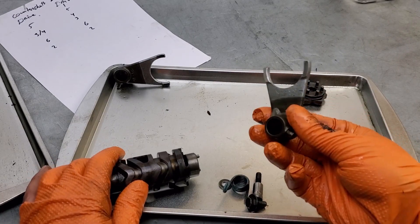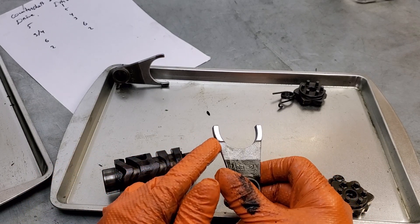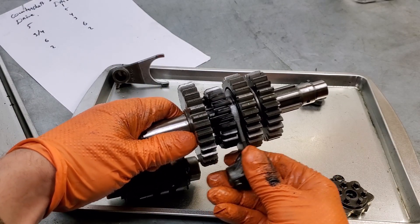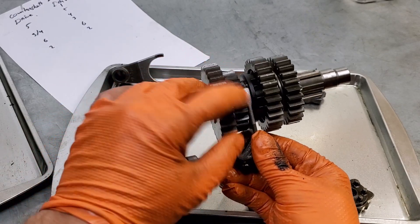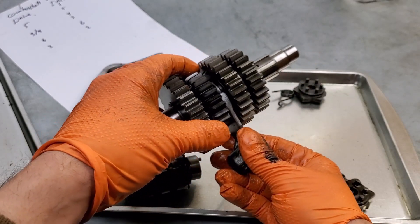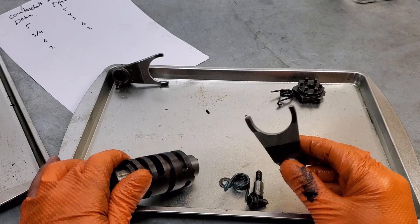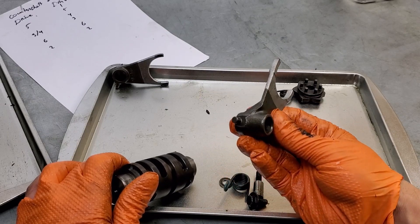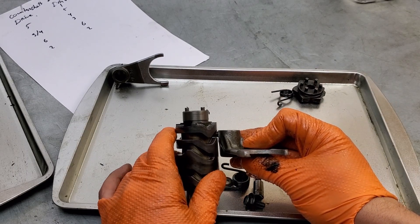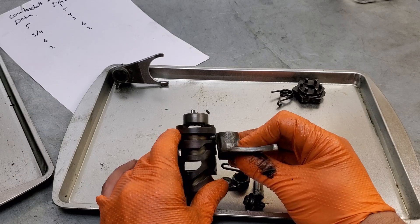On the shift cam and shift forks side - when somebody says your shift forks are bent, what they usually mean is that these guys get worn or jammed and are actually not able to move the gear around. This is all that the shift fork is responsible for. It glides along and when pushing one direction or the other, it engages the dogs against the appropriate gear. How this contraption works is you have a pin on the shift fork that rides along a channel. When you're shifting, the cam turns and at some point it forces the fork to move down and then up for other gears.